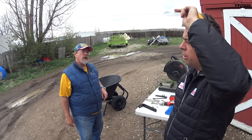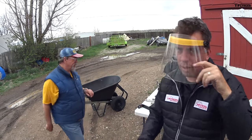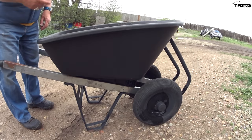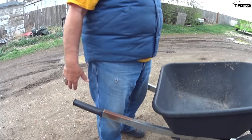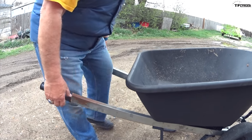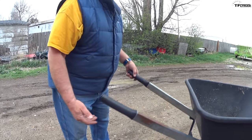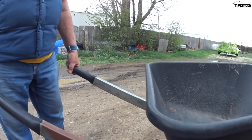Why install a weight distribution hitch? You're building a truss between the truck and the trailer. Can you demonstrate? Sure — this is a wheelbarrow, a dually wheelbarrow. You've got these handles; the longer the handle, the better the leverage. If I was lifting this with a whole bunch of cement in there, I'd have a hard time. But if I go out to the end of the handles, I can do it with one hand. So that's basically weight distribution arms, and having those long arms out there, if you lift up the trailer hitch, it actually spreads the weight to all the axles — all the ones in the truck, all the ones in the trailer. So it's called weight distribution.